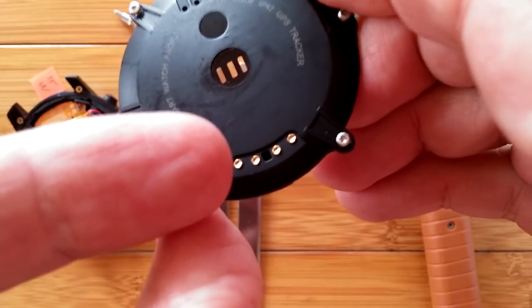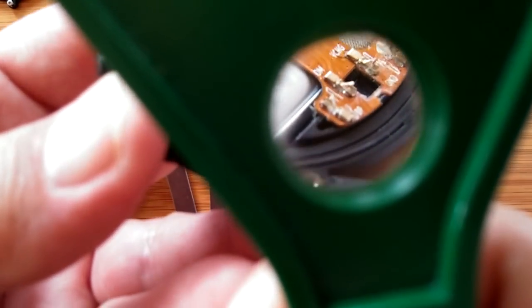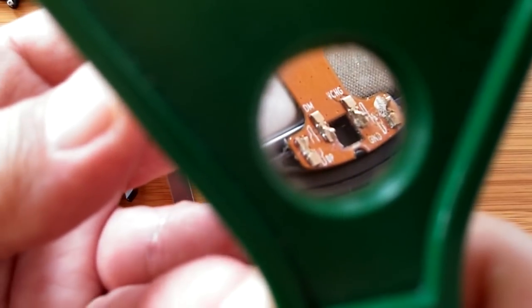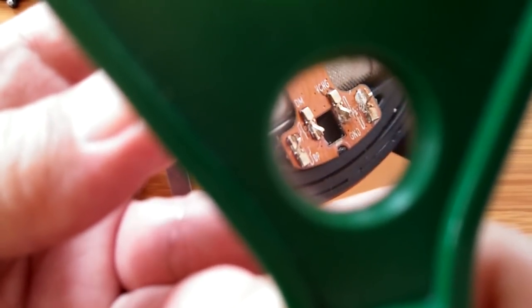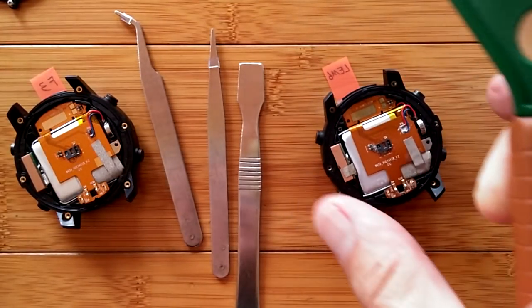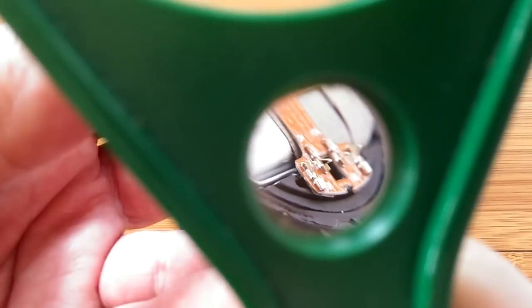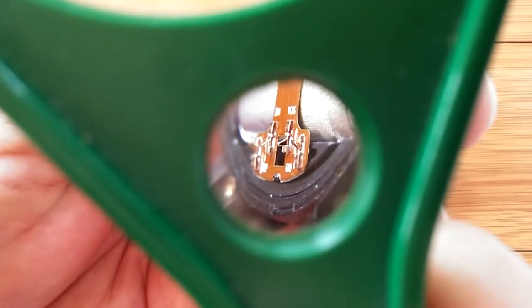These are the pins — this is where your charging connector goes. On the other side there are these flat little metal plates and they press against these little raised connectors. There are four of them with a kind of spring action to press against those plates, and there's corrosion all around them as well. I spent a lot of time trying to make sure these were making good solid contact. Because it's a springy thing pushing up against the metal of the back cover, if it gets a lot of vibration it might interrupt and your watch might suddenly turn off. If that happens, it might be because the spring action has softened over time.